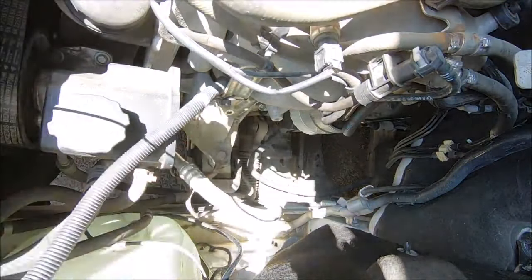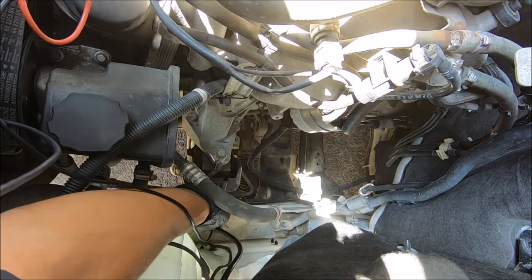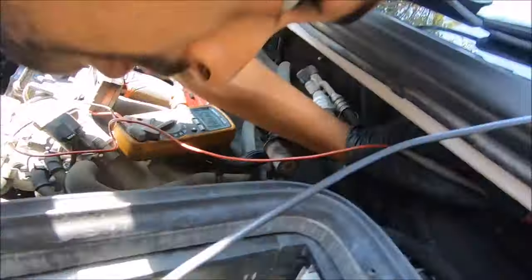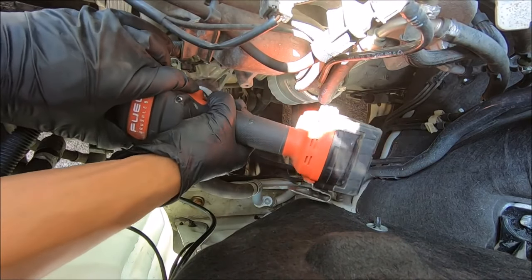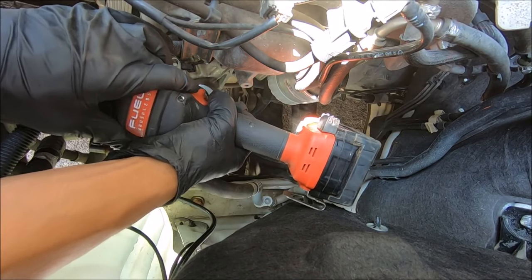Before mounting the cable and securing it in place, I used a multimeter to test the resistance between my desired points, just to make sure it's within specification. And it had a fairly low resistance. You don't want to run a new cable and have high resistance between the body and the chassis, or between the engine and the chassis.